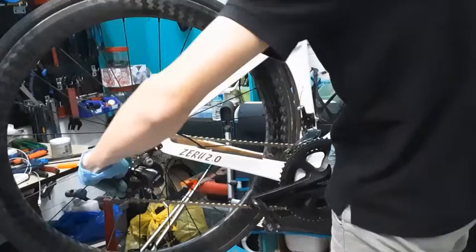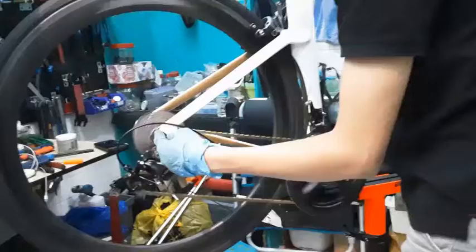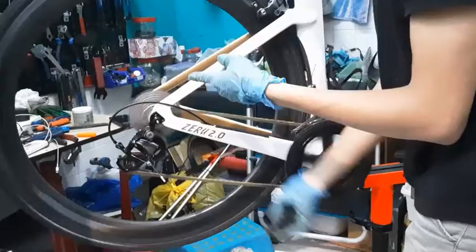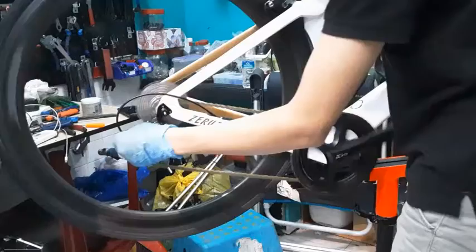So my shifter is on the third gear, right? I want my chain to be on the third gear also. So I just keep spinning until it moves to the third gear. Yeah, it jumped up to the third gear already, but there's a lot of sound and everything. That means it's not on perfectly. So you want to keep spinning it